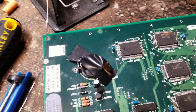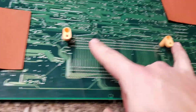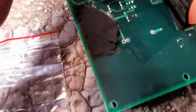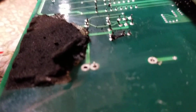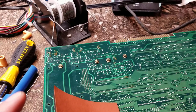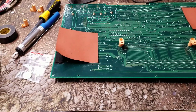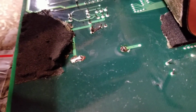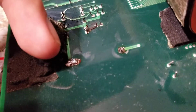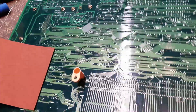I covered the back with a piece of electrical tape to keep it in there. Flipping it over — you can see I haven't even taken the PCB feet off the cartridge slot. You can see that black gunk; I cleaned it up a little bit. You can see one leg here and another leg right there. I'm going to solder that up. I watched a bunch of videos on this before I tackled it, and I saw this one had two pads next to each other — I've watched a couple of people bridge those, so I did the same. We'll see if that works.